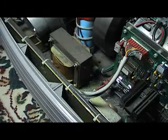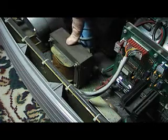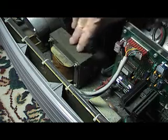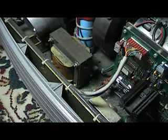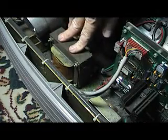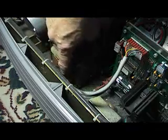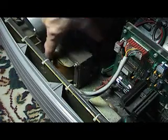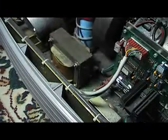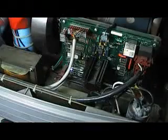On the Life Fitness 5500 treadmill, it still has a motor inductor. A lot of your machines do. This is kind of a noise choke. It helps keep these DC motors quieter than what they normally would be without it. Although if your machine is experiencing high heat, this is a good place to see it. Right along this inner band where all the windings are, if your machine is getting hot a lot, this brown paper will actually be burnt. Kind of like if you got a paper sack from the grocery store too close to the stove.